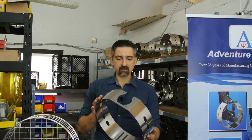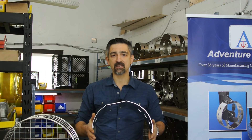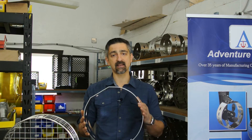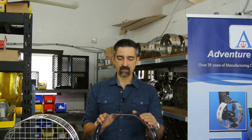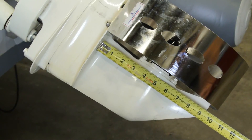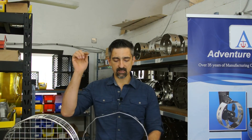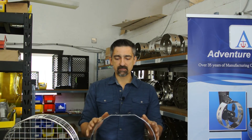What size is right? What size do you need? We offer sizes ranging from 9 inch all the way up to 17 inch, including a 17 inch high performance guard — that's for boats over 200 horsepower. Make sure you get the right measurement. You're going to be measuring between the anti-cavitation plate and the skeg. All the links are in the description below and it's on the website.